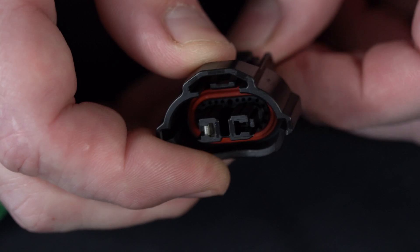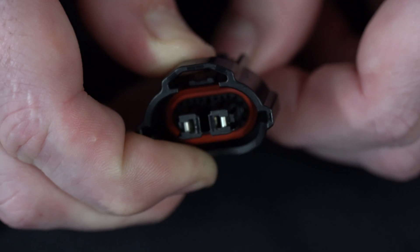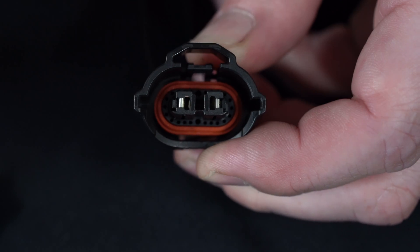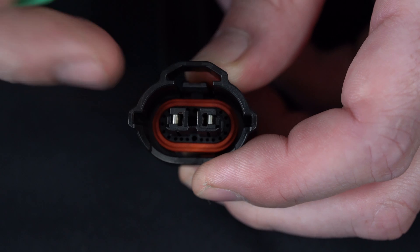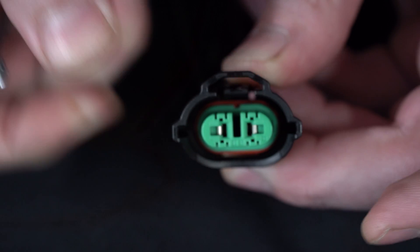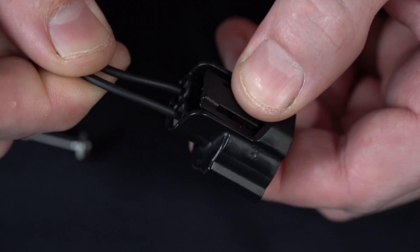Same deal — wire through the back. Wait for that click, and you can pull the pin back just a little bit if you want, just to make sure those catches actually fall back into position. As long as those catches are back flush, take your top cap and reinstall it. Once you get your click, now you've got a connector that's been repinned.